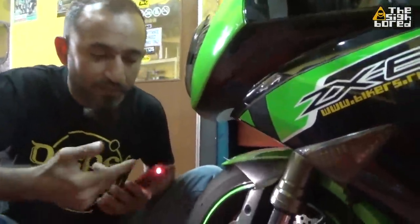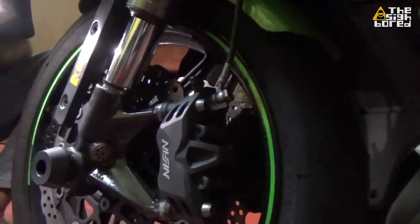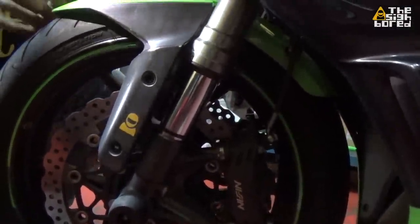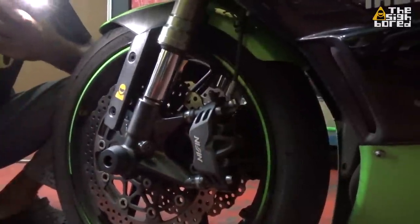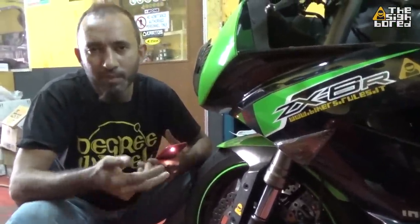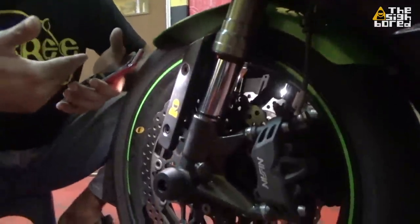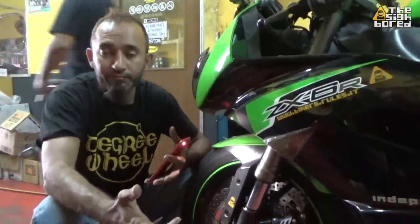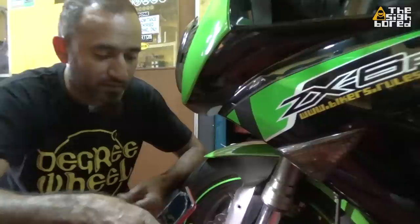When you have that feeling, first look if there is any oil, water, or debris caught in between, or if any chips have happened. In this kind of case, it's recommended to service the caliper, because the brake pads might be contaminated. Service the caliper because the heat will eventually burn up the oil. After you do a suspension service, go for a spin in a safe area and apply continuous braking — not stoppies, just continuous brake so it heats up the pads. When the pads heat up they will burn off any excess oil. Best is to also clean it with a brake cleaner to remove the oil.